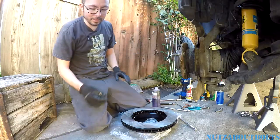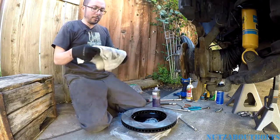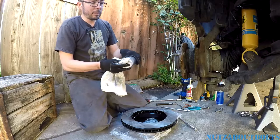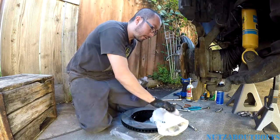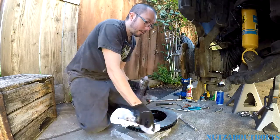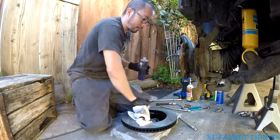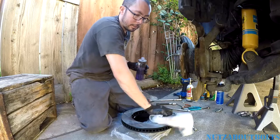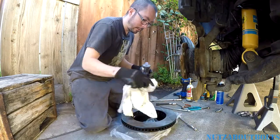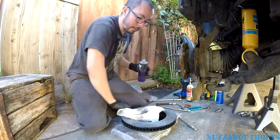When you get these rotors out of the package, the zinc-plated ones don't seem to have any oily film on them. But when you get your typical rotors, they've got an oily film on them — you've got to clean that off. Definitely don't want to go down the street with oily brakes. I'm going to go overkill and use a ton of acetone to get these as clean as I can.